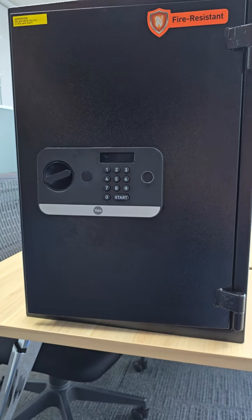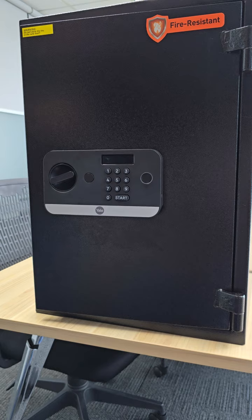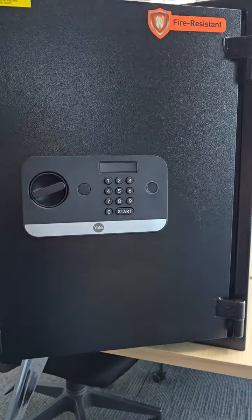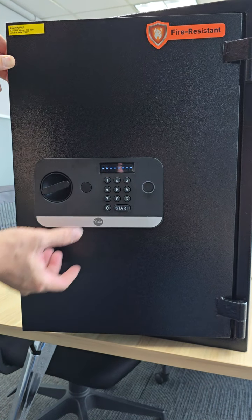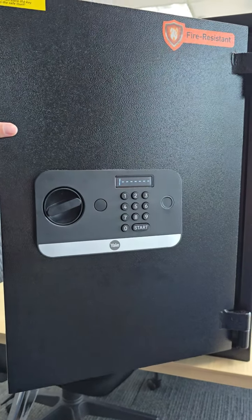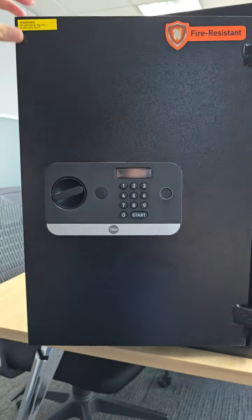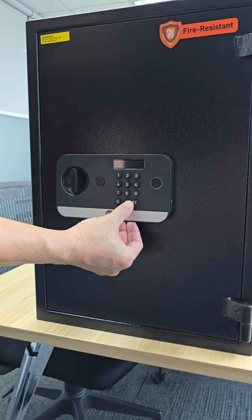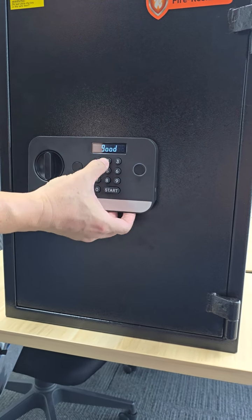How do you do it? Very simple. When the door is open, press the start button, press 1, and press the red button behind the door. You will see C and F — code and fingerprint. So now lock it, enter your pin code, press start. You will see it confirmed.